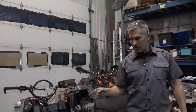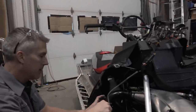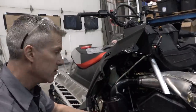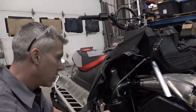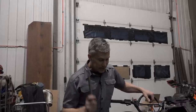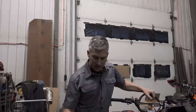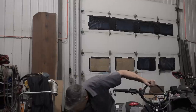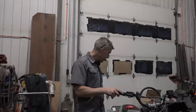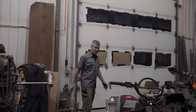This is a painted Jaws can — it's epoxy paint, not ceramic-coated. We've got to bring it up to operating temperature once, let it sit and cool down, then give it a good rip. The epoxy paint hardens up and needs the heat to cure it — warm it, let it cool, then bring it back up to operating temperature as per Jaws' instructions. If you want to buy this can, give us a call here at Power Mods — we have access to all of Jaws' products. We've also got posts and crossmembers; this is a muffler brace but we're not putting that on just yet, since low snow conditions tomorrow risk smashing A-arms up pretty good and I'd rather bust those than my nice new titanium stuff. Thanks for watching, keep coming back — we're going to do some more shaving of weight on this beast. I think we'll do the seat next.